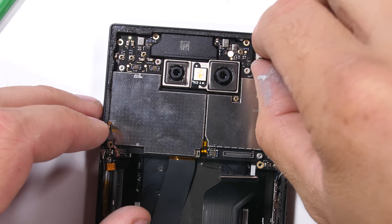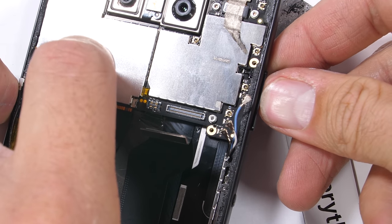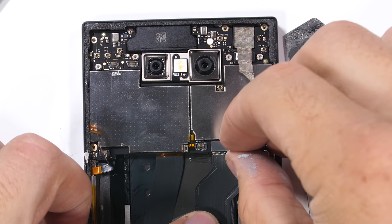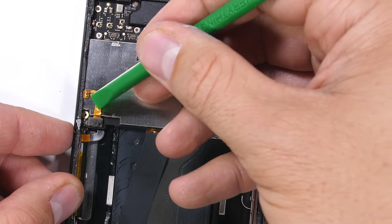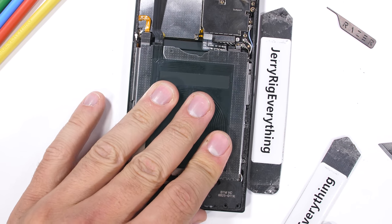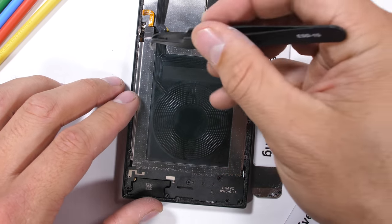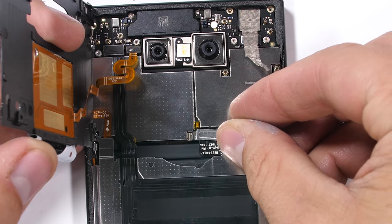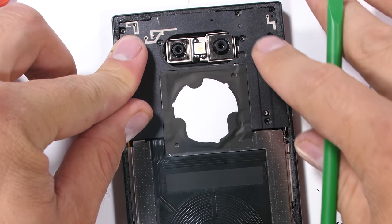I haven't turned on this phone in a while — pretty sure it's dead from the LED flashing on the back for a few days. I'll plug in the large charging port ribbon cable, which clips in like a little Lego, as well as the power button ribbon on the left side. Then the whole cool-looking battery and wireless charging contraption can slide back onto the phone. I'll plug in the LED RGBs, add the metal bracket over the battery connector, and set down the protective plastics over the motherboard.